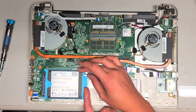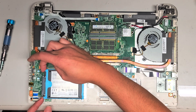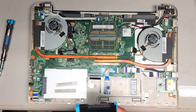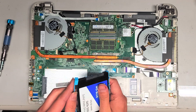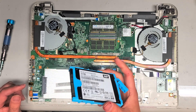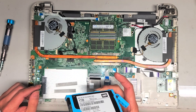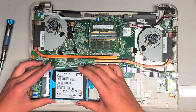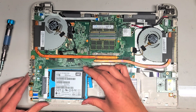To remove the hard drive, you've got to pull this rubber piece out first, then just grab the hard drive and pull it back. This is a 1TB SSD that we put in here. The rubber piece has these little dimples that go into the screw holes, so just line it up and put it back on. If you are going to upgrade or change your hard drive, make sure you either cloned your old hard drive to the new one, or that you're going to install the operating system clean with a USB. If you're not sure how to do that, feel free to mention it in a comment below and I will forward you the video on how to clone your drive.